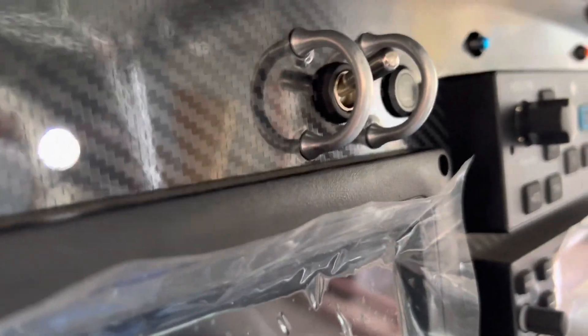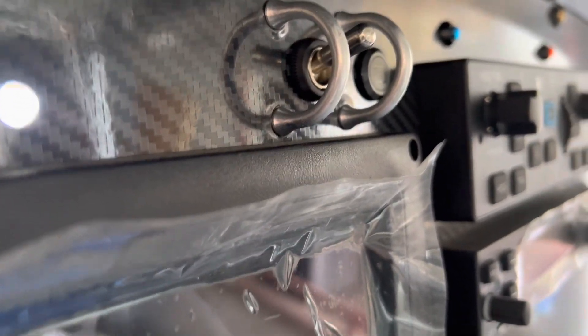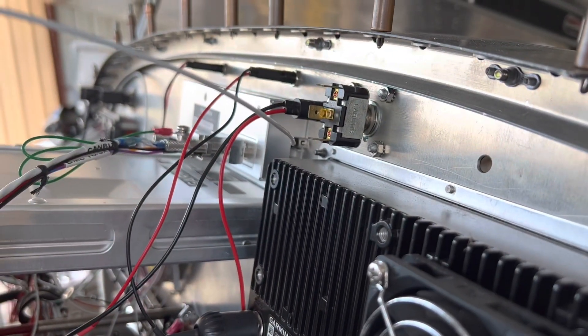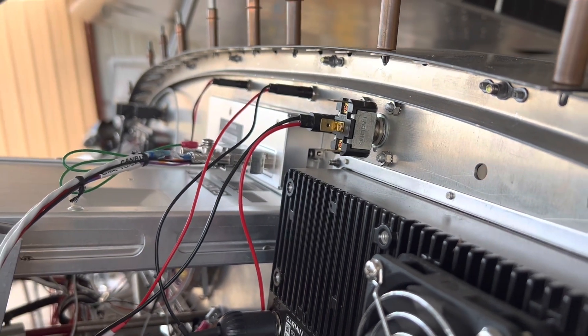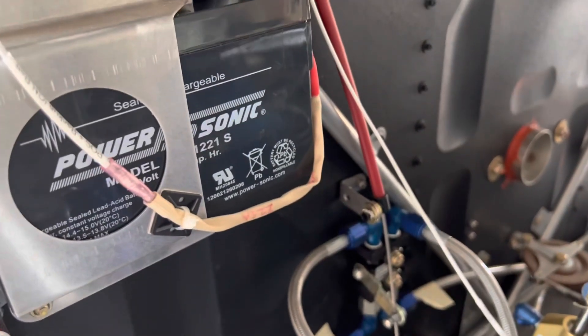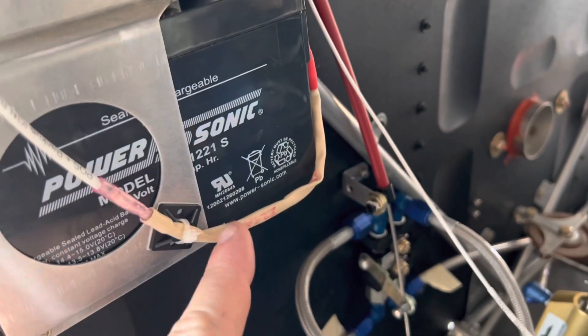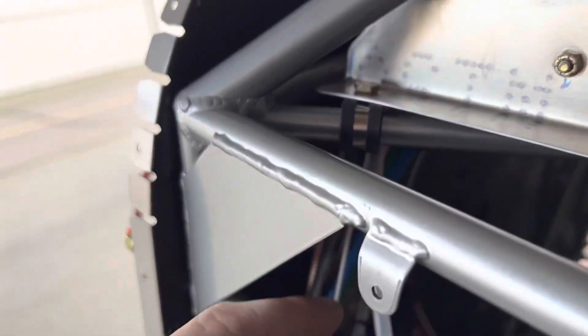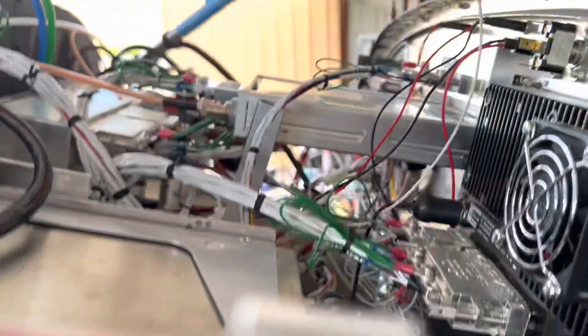Because there was nothing in the Light Speed drawing showing any type of fuse protection, that's the purpose of the fusible link coming out of the battery. If there's some sort of catastrophic issue, this fusible link is just going to burn the 22-gauge wire before it starts causing issues with the 18-gauge wire running all the way up to your switch.